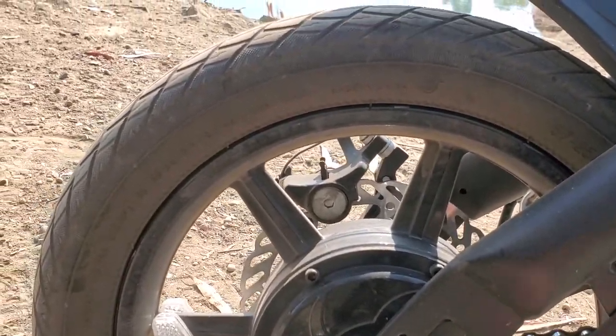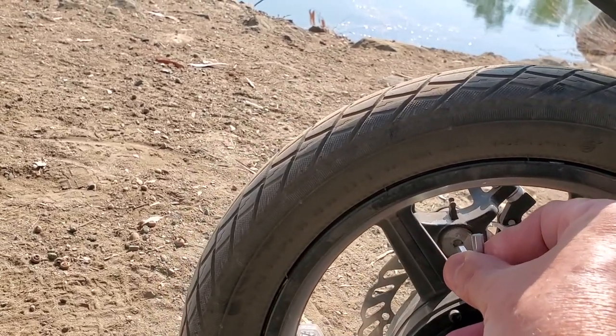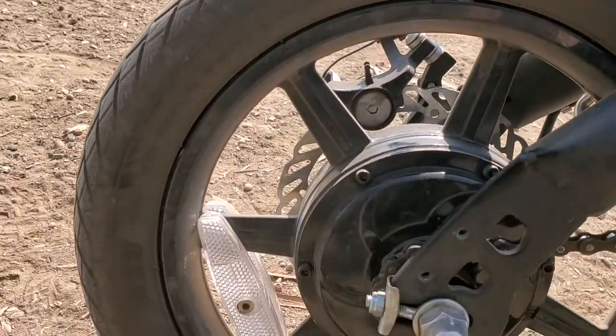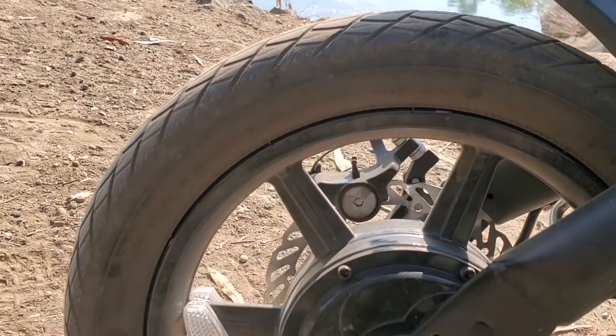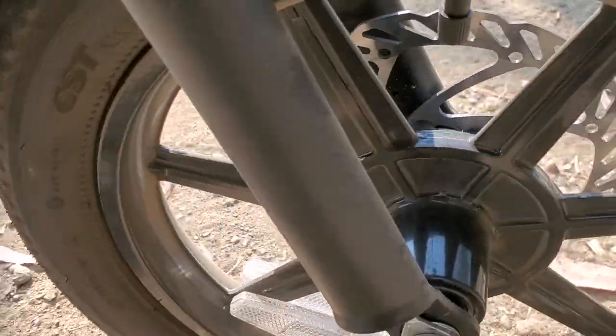What you want to do is reach behind the brake caliper and turn — left to loosen, right to tighten. I suggest doing it every half turn, so from the allen wrench down, do a half turn and test it. Keep testing until it's in the right spot.